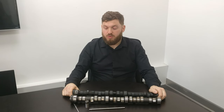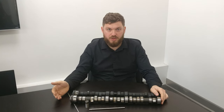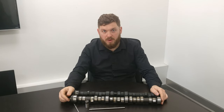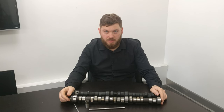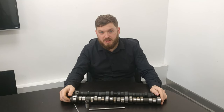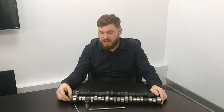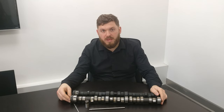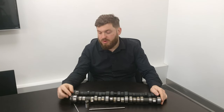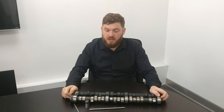There are a number of different ways companies use to time the camshaft to the crankshaft. Sometimes you have a toothed belt — most modern small engines use a toothed belt — which is catastrophic if it fails, because the pistons carry on moving and the valves stay where they are, causing pistons to smash into valves. A rubber belt is probably the easiest thing to break. The other common method is a chain, which is stronger than a belt. But what Rolls-Royce use is a gear.